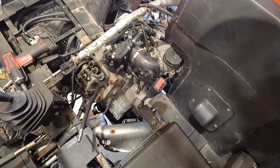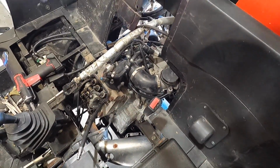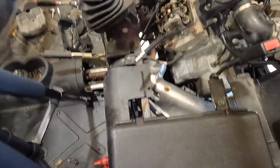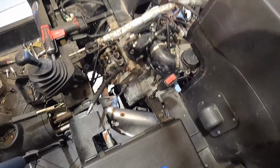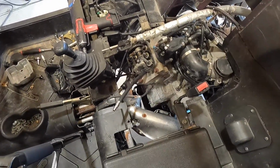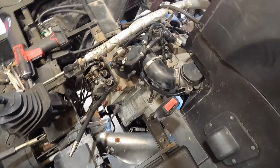And I didn't even think about it when we had the clutch off to check that and maybe replace that. And I replaced the switch. So it's probably got a broken ground wire somewhere in here making it show, because this thing operates by grounding.